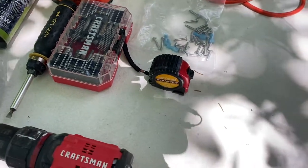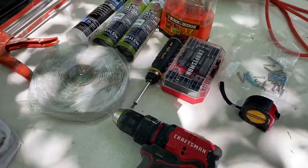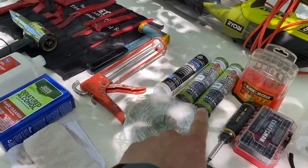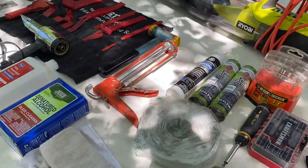I've got all my screws up here for the entire kit, inside and outside, and a tape measure just in case. The manual says to measure about two inches from the opening to place your sealant. Your job is going to go much faster if you collect your tools, get them in place, and have them handy instead of climbing up and down the ladder 50 times. I've seen people do that in other videos and they end up saying the fan took four to five hours - I truly do not believe this is a four to five hour project.